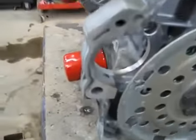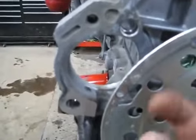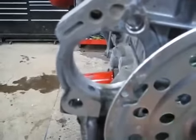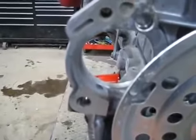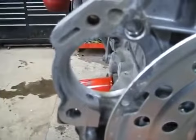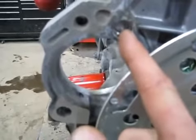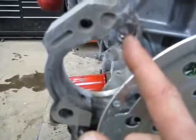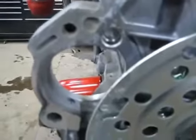One thing I found is that when you slide the starter in, its threads are on the transmission end, so you have nothing to bolt the starter to. That's an easy fix. All you have to do is machine up a bung that presses into here with some internal threads on it so your bolt can terminate right here with the threaded bung pressed in there.